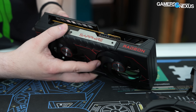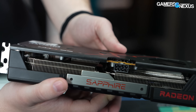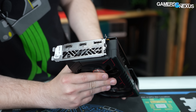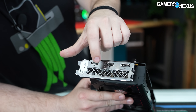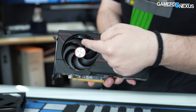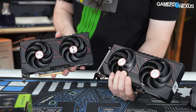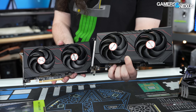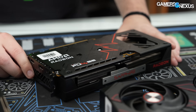This is able to breathe fully. There's a large gap there into the PCB, and just looking down it, there's not a whole lot going on for the cooler, which makes sense for a cheaper card. For I/O, we have three ports, and it is perforated, but there's no exhaust through the fin stack — it's vertically oriented. This card looks identical with the exception of the PCB length, which is a little different. The 8-gigabyte model appears to be slightly shorter.